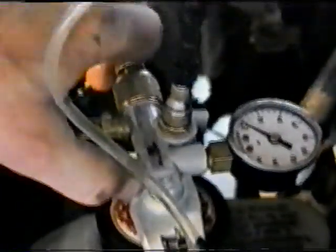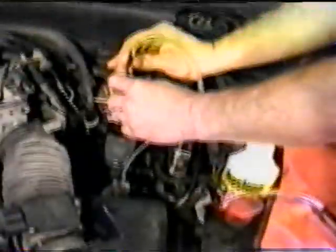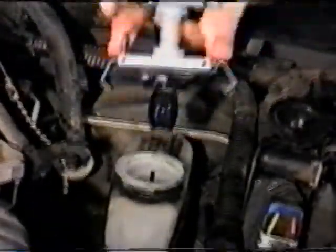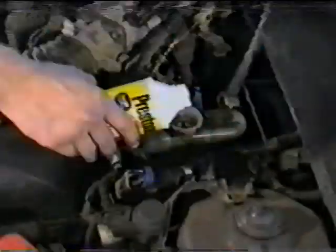With the system pressure at zero PSI, the slide valve can then be pushed across the bladder circuit, deflating the bladder. The bladder fluid will also be dispersed through the relief valve outlet. Once bleeding has been completed, disconnect the injector's fluid outlet from the UCA. Depress the spring-loaded neck clips and remove the UCA from the vehicle. Fill the reservoir as necessary.